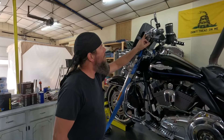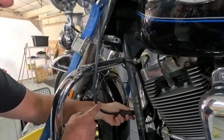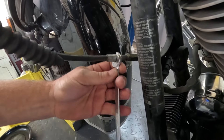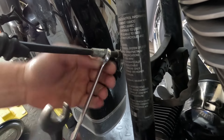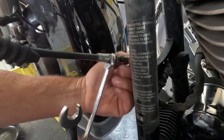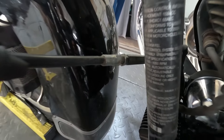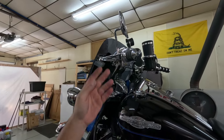All right, from your clutch lever, you're going to have a cable. It comes out — you follow your cable down, and what you're going to find somewhere along the line is this corrugated rubber boot. Slide the boot back out of the way, and what we're going to do is take a half inch and a nine-sixteenths and loosen this nut. This is the lock nut. Once we have that loosened, we're going to shorten the cable to put slack in it before we do the actual clutch adjustment. Now there's a good bit of slack in the cable, so now we can go down.